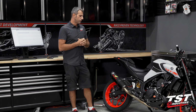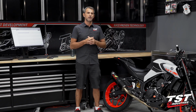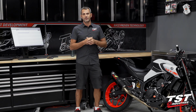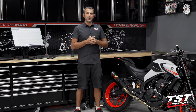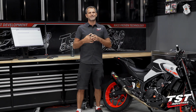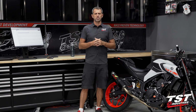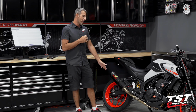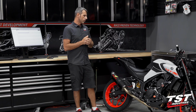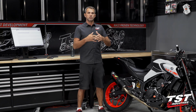I had a lot of fun. I played around with the suspension variables. I had to change some geometry variables. Last time I had this bike out was at a very tight track in Bushnell, and what I set it at was just not working for me at Jennings. It was twitchy, it was just terrible. So I do have a longer wheelbase on it now, that helped, and I worked most of the day trying to calm down the geometry parameters to work with me.